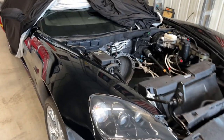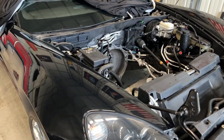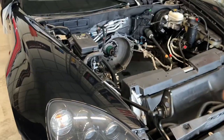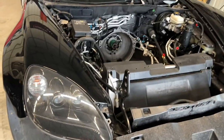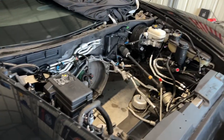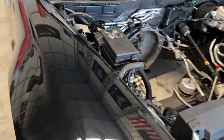I haven't decided if I'm going to add another expansion tank over there or in the trunk just to keep the blower a little cooler, because it's going to spin faster before it has to make boost since the engine is going to be that much more efficient. For the people that understand tuning — boost is a measurement of restriction. The RPM it spent on the last motor versus what it's going to spin on this engine, it's not going to have the same back pressure boost it had on the old setup.